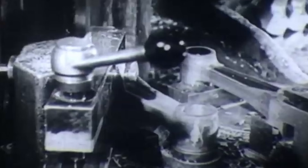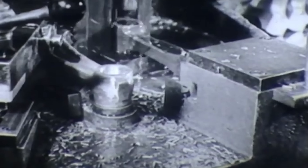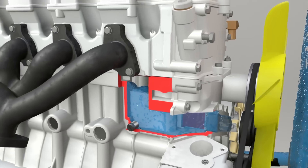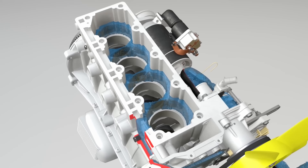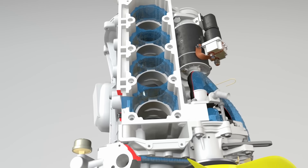When you look at the 24H, you can tell Arsenal was basically asking: how far can we push piston technology before it stops making sense? And the 24H is right on that edge. Fork and blade rods, dual superchargers, complex gearing — it's very much in line with the late-war max-effort engines like the Merlin and Allison, just taking a step further in size and power. Cooling a 70-liter H24 was always going to be a challenge, and Arsenal had to get creative. Coolant passages were cast directly into the blocks, detachable heads made major work at least somewhat sane, and those after-coolers in the intake manifolds helped keep charge temperatures under control at high boost. They paired all of this with water injection, which is what kept detonation in check when they pushed for 4,000 horsepower at takeoff.